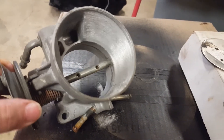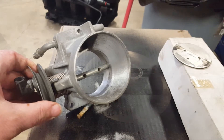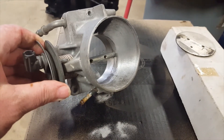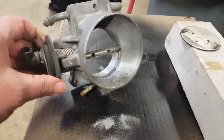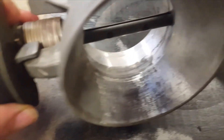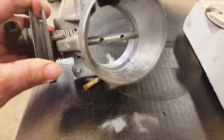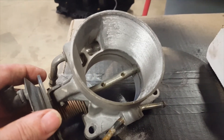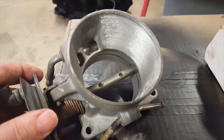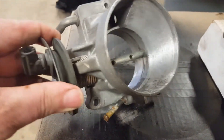Yesterday I was going to bolt my throttle body on the 5.3 I'm doing for my S10 and it was so white and crusty from sitting outside. The throttle was seized inside. You can see it had a lot of water in it and it really pitted up the aluminum in the throttle body. So I tore it apart and I actually put it in my glass beader, held it about two to three feet away from the glass bead just to get the white off without taking the original finish off.